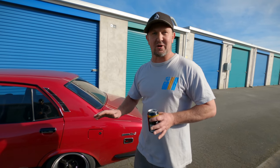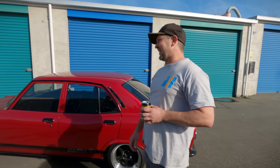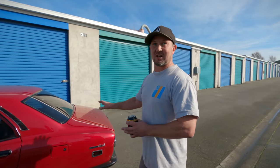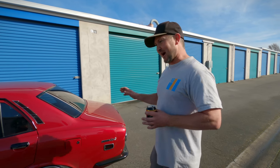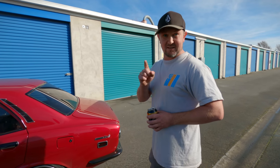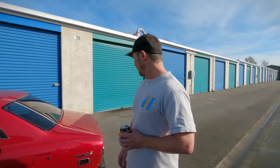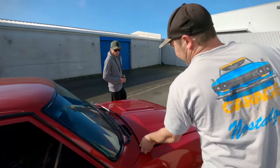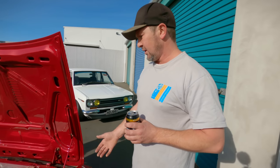Never trying to build this car to be pretty - this car is way too pretty for me. These get driven hard, as they should. My mate had said if I bought another car he'd buy my other one, so literally that next week I rang the guy in Nelson, said I'll take it, and next thing it was on its way down. My other car, which my mate Ryan's got now, is still in the build. The paint was the one thing I couldn't fast-forward - always wanted it to be as straight as a nail. Unfortunately the motor was no good, so we had to rip that out. She's running a Series 5 13B now, just with 48 IDA carbs and a Davis Craig water pump, which I highly recommend - first time I've used one but this thing just sits at a certain temperature and it's perfect.